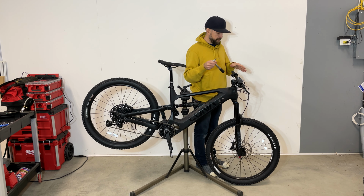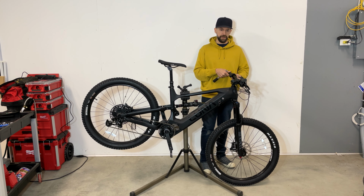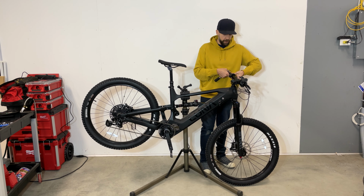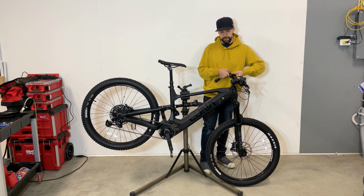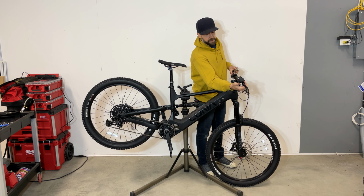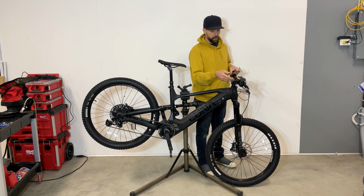Move to the controls. Make sure you don't over tighten the levers and shifter. The reason is simple. If you crash, if they're a little bit loose, it will flip like this and you won't break a lever or a lever blade. Same with the shifter. Just enough so we can put it back. Same with the display. If it's too tight, you will break the bracket.